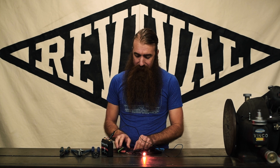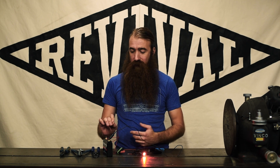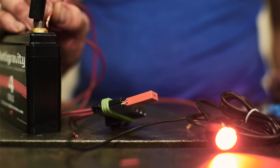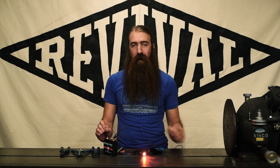We'll put this solid-state circuit breaker in. Our light came back — and now short circuit. I'm just holding this on there. No light is on, current is not flowing, wire is not getting hot, nothing's happening. And now as soon as I take that short circuit away, magically this thing just starts to work again. This is also really handy for troubleshooting a problem. If you've got a short or an intermittent short and you're riding along and everything goes dark, you replace your fuse and it works for a while, but you're not sure why. This way you can go through the loom, jiggle wires, and see when the light comes on — it'll help you identify where you have a problem in your loom. Short circuit. There's a problem. If you didn't know where it was, you could be searching around for it. And then as soon as you find it, fix the short, the light comes on — indicates you found the problem. Really handy for troubleshooting.